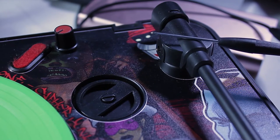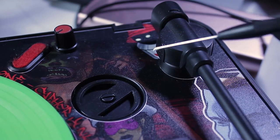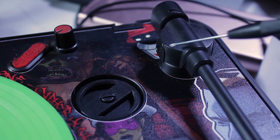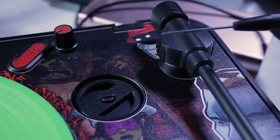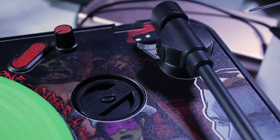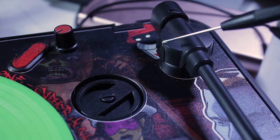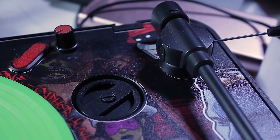You're going to want to use a nice, very thin screwdriver. Right here on the side there's a little crossbar that goes across to act as a pivot for the original tonearm. You're going to want to go on the outside and push it through this way. This is the side that's a little larger, so it can't go the other way — that's why I mentioned the bigger hole in the tonearm. You're going to need it so the larger end fits in there. Come around on the edge — it's going to take a little bit of pressure, but push it through.